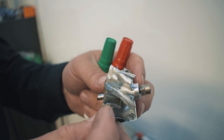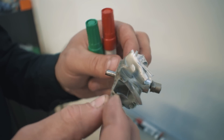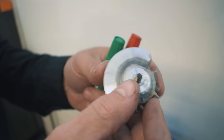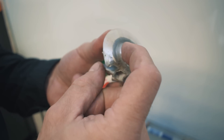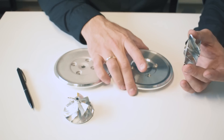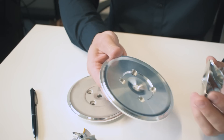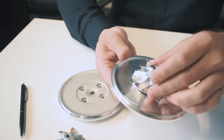As you can see, this is a common problem of failure. When the turbocharger fails it most likely breaks here. Adding additional material will help avoid cycle fatigue. Due to the new impeller's back face we had to make a custom back plate, which you can see here on the right compared to the original back plate on the left.